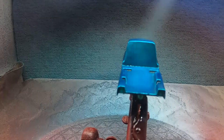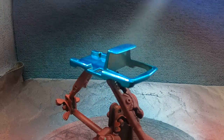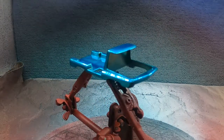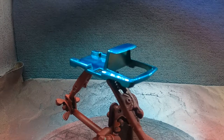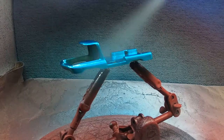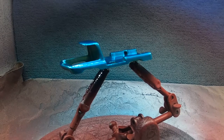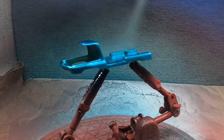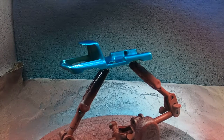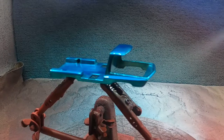As you can see, it's going on really nice. I kind of have a heavy hand when spraying, but you have to be careful or else you'll have runs and sags in your paint job and you'll be stripping it back down again. Make sure you've got nice even coats. It's going on really nicely and I really love this color.